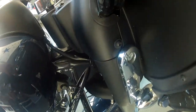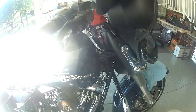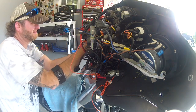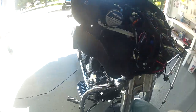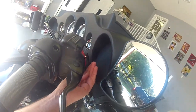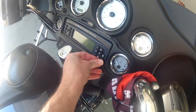For this 1/8-inch wire, they tell you that you can run it right through the grommet where the handlebar comes out of the fairing — right here. You can run it out right there and come around up to your auxiliary input. I believe that's the way I'm going to do it. As you can see, now we're out right here. What I'll do is probably run it up and over, come from the underside, up and over like that, and plug in just like that.